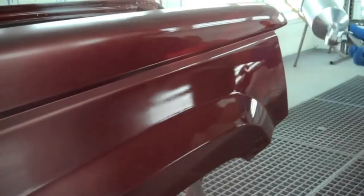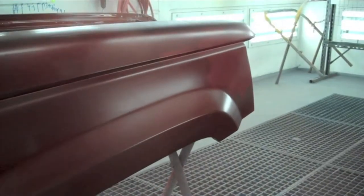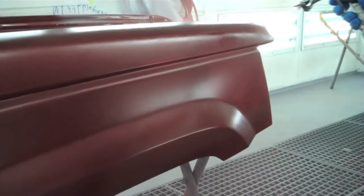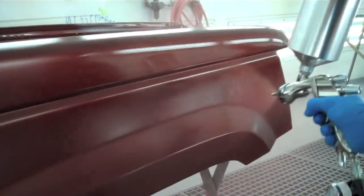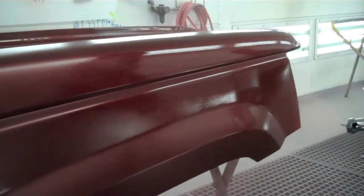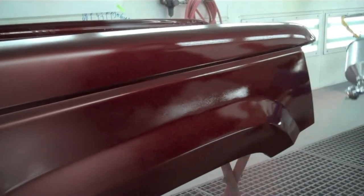I know it's an old joke that watching paint dry is boring, but if you think about what goes on when paint dries, it's actually kind of complicated. We throw this stuff through the air and it hits the panel, and during that first couple of minutes, we want the metallic flakes to orient properly. We want them to sink in the film, and we want the tint package — that is all the colorants that make up that color —